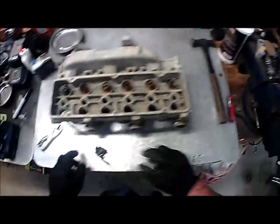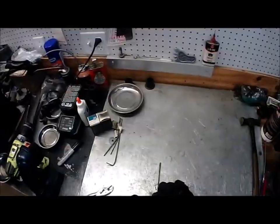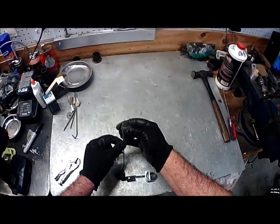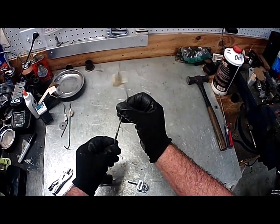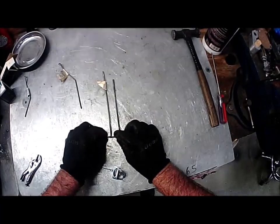What I find interesting about this one is this is an early model choke setup. I'm going to throw this head away unless Tom wants it. Anyway, this is the early model choke setup, which is kind of funny. And if you look here, this is a late model choke — you see the difference in the offset there. They offset those things because I believe this little nub would barely stick out of the top of the head, and when you went to screw in the rod it would push down in there and it was hard to screw in — you couldn't really grab a hold of it. So later on they upgraded it to this newer one. You can see they're about an inch difference in length.